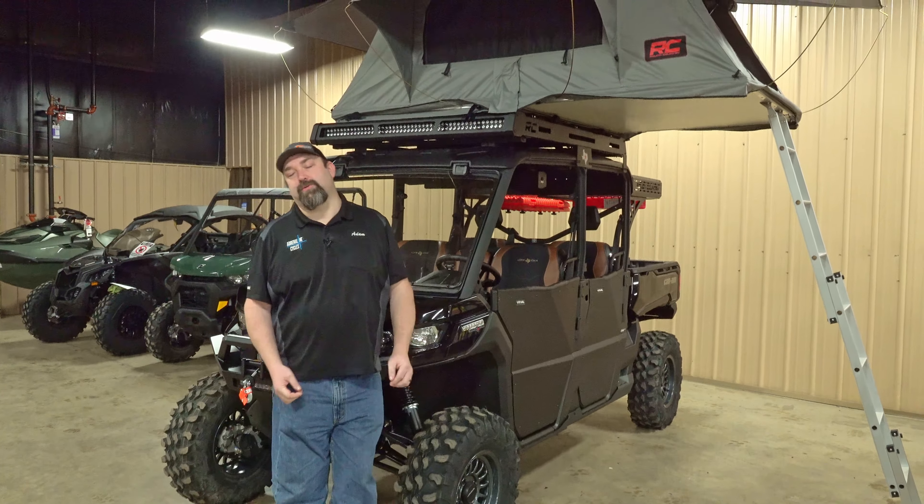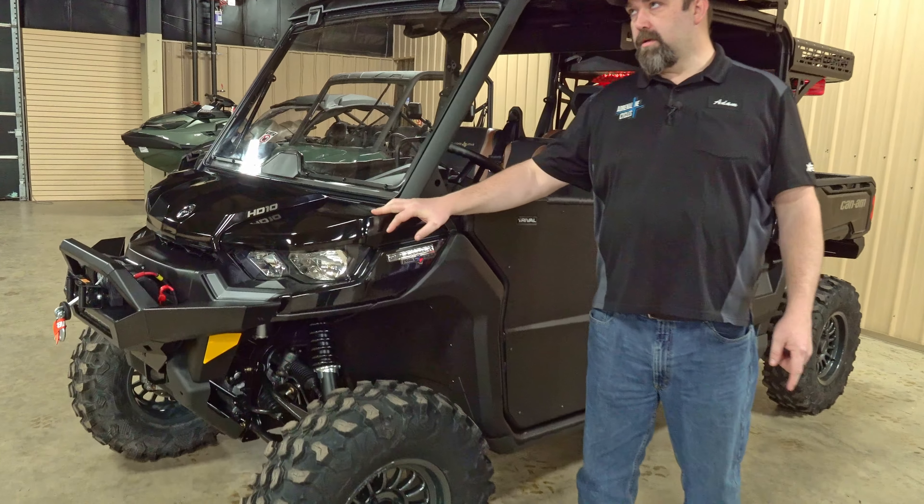Moving around to the side, we'll talk about the wheels and tire package and some things we've done to the suspension to accommodate added weight. The wheels and tires are 31x10x15 Maxxis Carnivores on a set of Method wheels. You'll notice they're not bead locked — they're called grip locks. What that is, is basically a bunch of ridges on the inside of the bead that helps hold the tire so we can run low pressure without the tire coming off the bead. It's really new technology in the side-by-side world, and Method has that on these wheels. BRP is calling the color 'night black.'